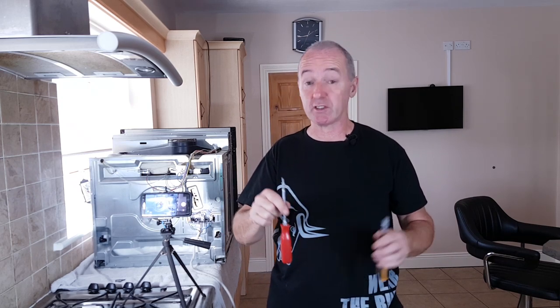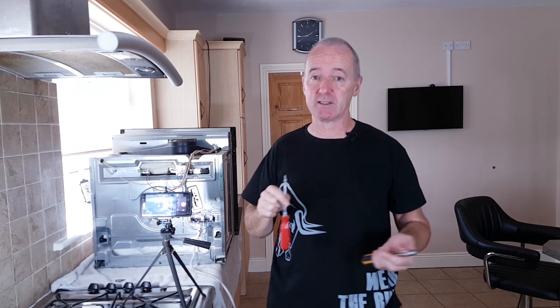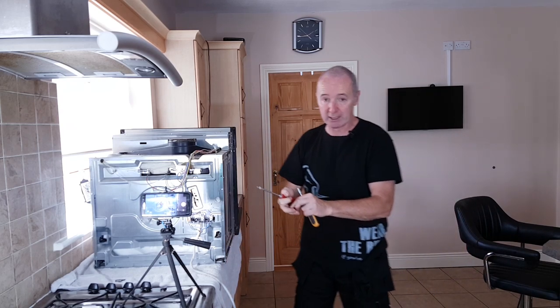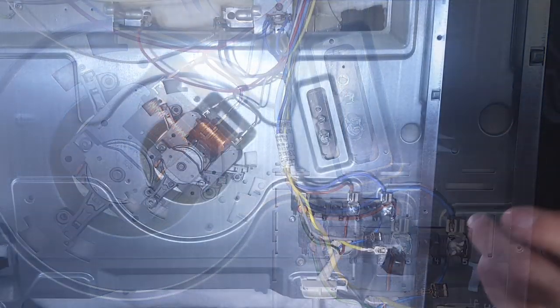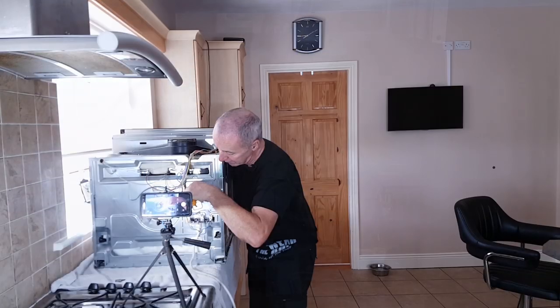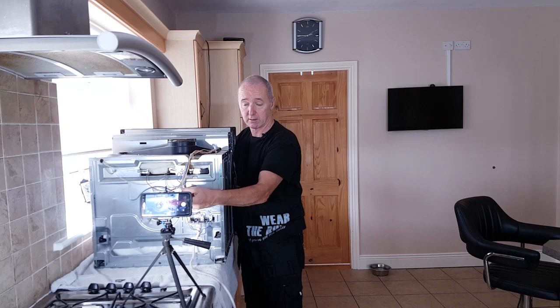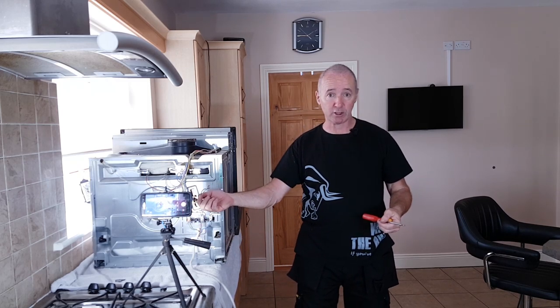These two elements should have been a lot closer in fitment, but the overall dimensions and wattage are perfect — just the plates don't really line up. Anyway, I've got a 4mm by 20mm pan-head screw and a 4mm nut. I'm pushing the screw through from the far side and using a little 7mm socket with the nut already in it, reaching around to set it up. I'm tightening the nut from inside and outside — and that's it, the element is now secured.